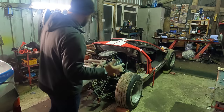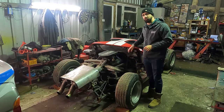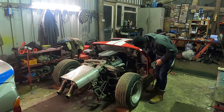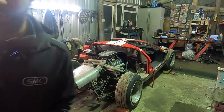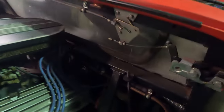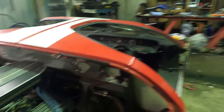I'm going to walk you around a couple of bits in the car straight away to tell you the things that really impressed me about the build. A lot of the builds I've seen online have got T-clips to stop you opening the rear clamshell, which is a cheap way of doing what Ivan has done. Ivan has done twin-release clams here — when you pull the handle, they open the rear clamshell perfectly. They're on a cable system which operates absolutely brilliantly: you pull one and it releases both of them in unison. We're going to be keeping that — we love it.